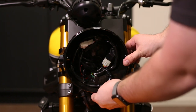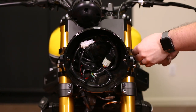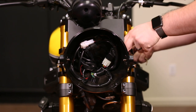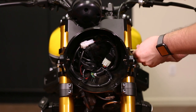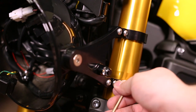This will square everything up with the side brackets and the fork rings — try to help everything be level and make sure everything's straight. Make sure your fork rings and shims all match up well. If one needs a little bit of adjustment, loosen it and adjust the shim. Now tighten everything up — it doesn't need to be too tight. We're talking only eight foot-pounds at the most.